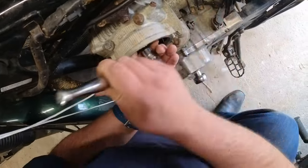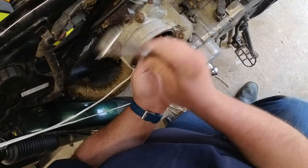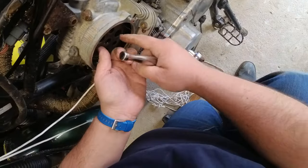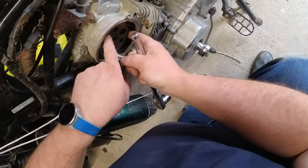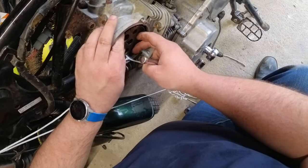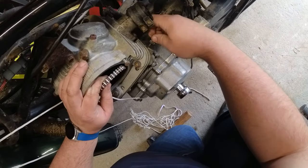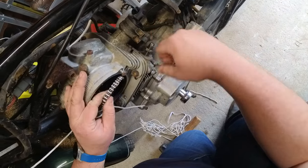So I'm going to grab the wrench and take this bolt all the way out. You can see that I'm cupping behind it just to make sure that nothing falls into the engine, and I'm also pressing back on the cam sprocket so that it stays against the engine and aligns with the registration pin. Now that's out - there's a little piece of swarf in there so it looks like someone might have been a bit evil to those threads, or it's never been off. I just popped my fingers inside the holes on that sprocket and I'm going to gently manoeuvre it off. It's a bit of a balancing act - you need to manoeuvre it off, get the chain off it, and then get it out of the hole. The workshop manual just says remove it, and I'm guessing it expects me to have a little more knowledge than I actually do as a home basher in my garage.